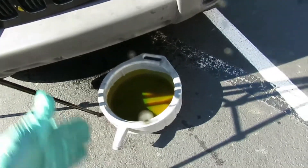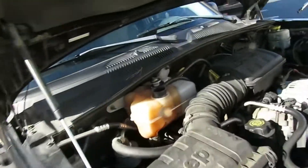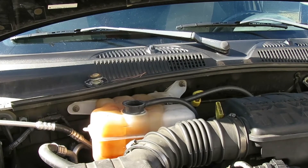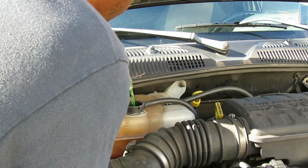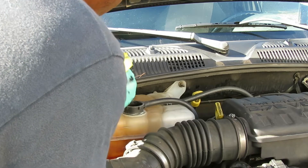Got our belt on. Pull the pan up under here — this is the old antifreeze, looking pretty clean, green antifreeze. We got a new bottle from Federated Global, 50/50 pre-diluted. We're going to fill this up. You see this tube right here — that is a self-bleeding system. So we're going to fill it up until we get way up there and we'll be good to go. I'll show you the skills of being able to pour it sideways — it's much easier to pour like that.